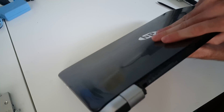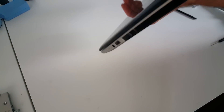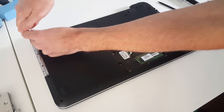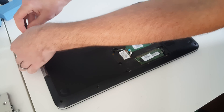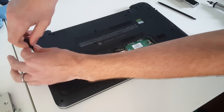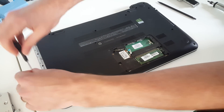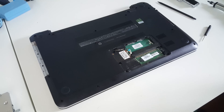I'm just going to tip these out. These are the same size screws as the rest of the base chassis. Then we do have three screws here which are a different type — sort of flat short screws — so we'll take those out. These are normally hidden by the optical bay. With those removed, we're ready to flip the laptop over.